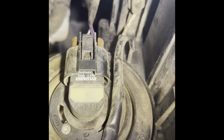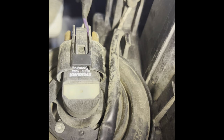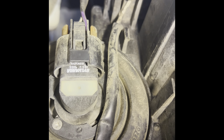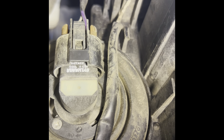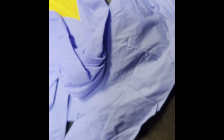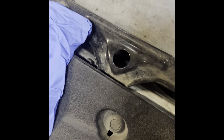That one is your low beam and this one over here is your high beam. You just slide off that little boot there, turn it counter-clockwise and it'll come right off. It's keyed to go right back in clockwise, and you change your bulb. Just make sure you wear gloves — any of these bulbs you touch, wear gloves, halogen or not. Those are pretty easy. You just turn them counter-clockwise and put them back in, making sure they end up back in the same position because they're keyed.